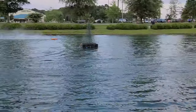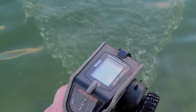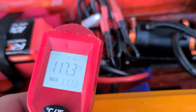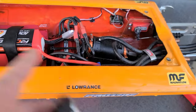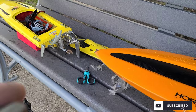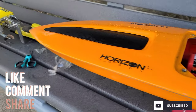I was out at the speed run spot doing practice runs and the prop shaft broke on my V2, so I'll have it back in action shortly with an upgrade cable. Temps came in at 120°F on the ESC, 117°F, and 106°F on the motor. GPS showed 52 mph right before it died. I hope everything I went over today about what I bring to the pond helps you guys out — it's always better to be prepared. With gas prices what they are, you don't want to waste a trip. Thanks for watching. Big B with Ironclad RC — where we tinker, test, and tune everything.